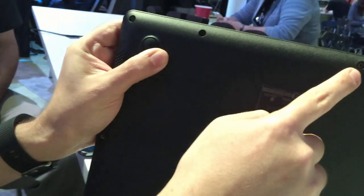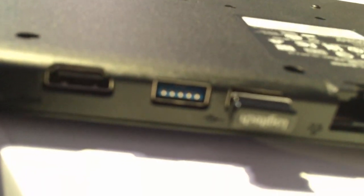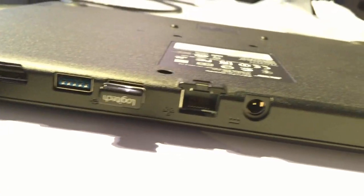Can you show me the underside and what was involved with replacing that 2.5 inch drive? We could actually open it right now. It only has very simple Phillips screws, and it's just a very small main board on one side. The hard drive doesn't even come fixed to the main board — you just slide it out. The more difficult part is getting the RAM slot changed because you have to take out the keyboard ribbon and then pull it out, but once you do that it's pretty simple.